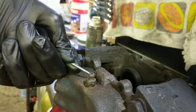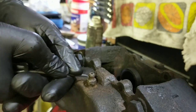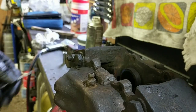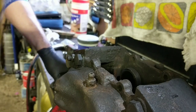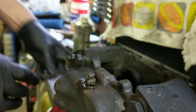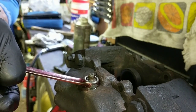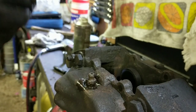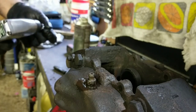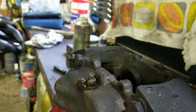Now this is an 11mm and I haven't got an 11mm impact in a quarter drive, so I'm just going to have to use a conventional deep chrome socket. See where that takes us. Give it a little squirt of the juice, see if that does anything. I will try with a spanner first — don't want to put too much on it. That is a lot of force. That will shear. I've experienced it before and that is going to shear, so I'm going to start with the Sykes gun here.